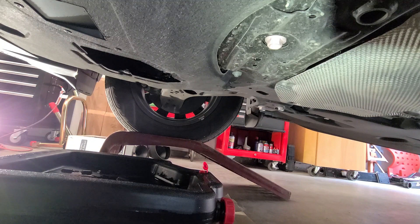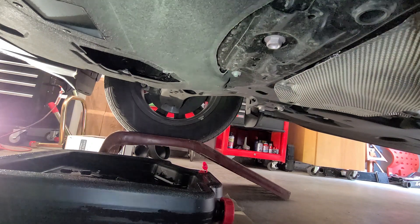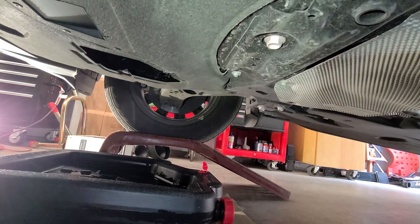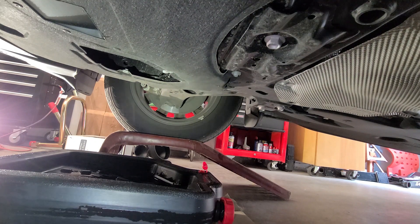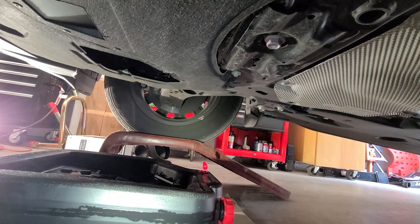Since I'm having trouble getting the oil filter off, I'm going to wait until the oil is done draining, reinstall the plug, and try again once I can get under it better. I've personally never used the torque spec when reinstalling a drain bolt, but my advice would be to use the torque spec. If you don't, under-tightening it a little bit is better, because you can always tighten it later if it's dripping versus stripping it out.